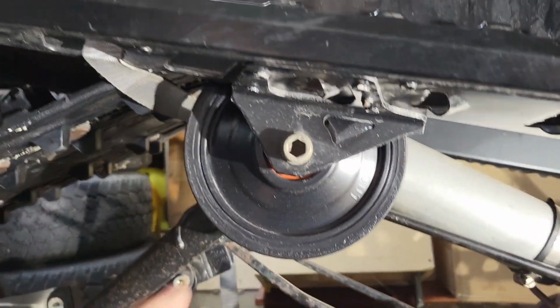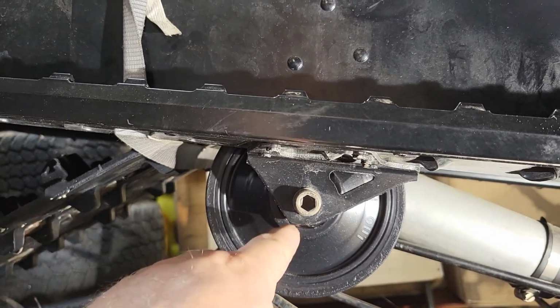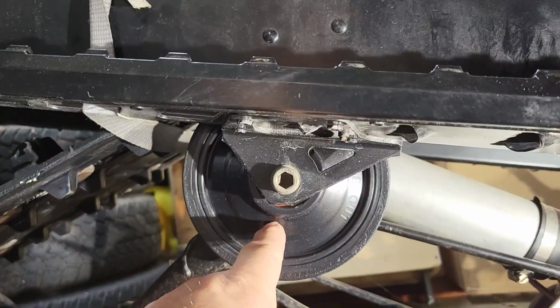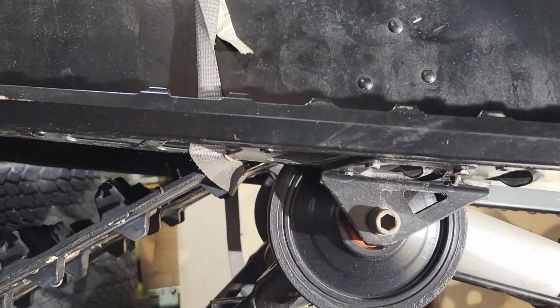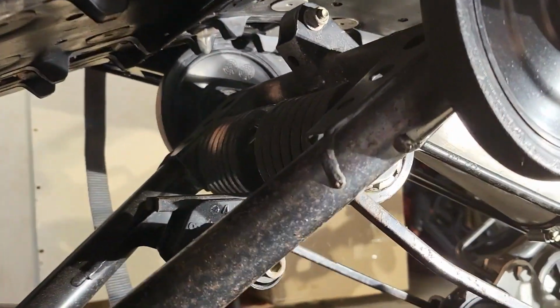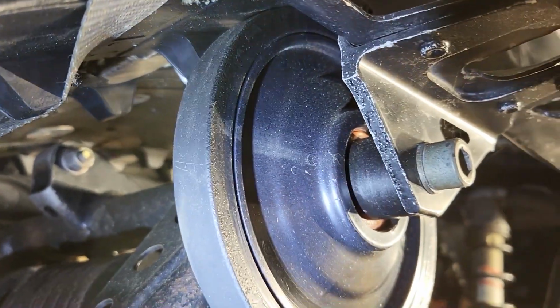The Renegade has an R-motion rear skid. This has an SC-5 rear skid. So let's turn this around and take a look. And here's your difference. The R-motion had that aluminum block, and then this wheel here was down here. So it goes straight across, so bolt right in that top part there.